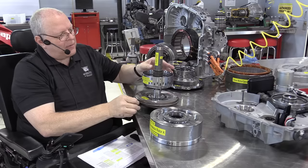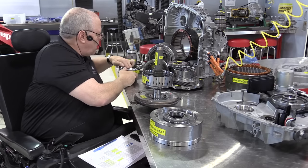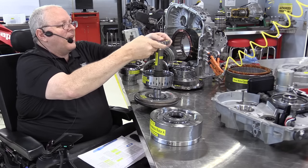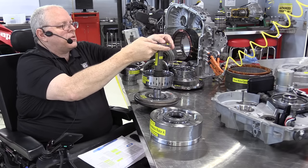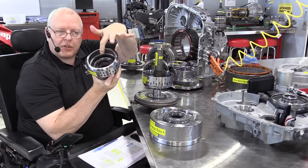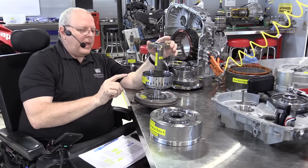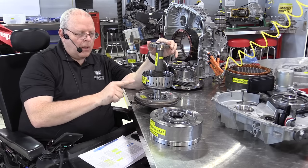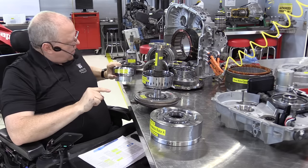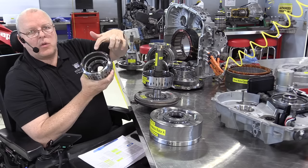And then through this hub shaft here, that goes up and connects to another hub of the variable high 2-3-4 clutch right there. And that is this clutch pack right here that connects to the ring gear. So we can connect the engine to motor A, and if we apply the variable high 2-3-4 clutch at the same time, we can connect the engine to the ring gear.